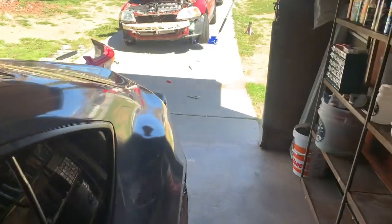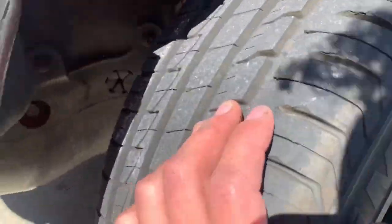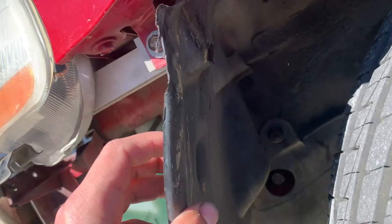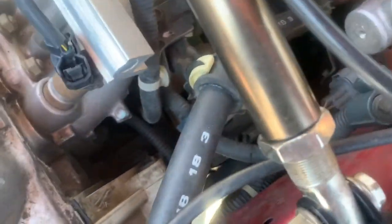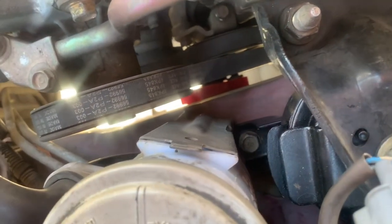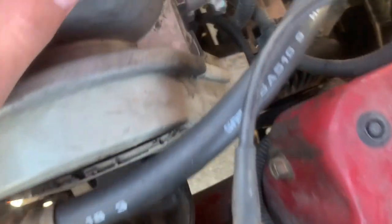Now it's going to be doing the power steering and all the belts, because she needs new belts. We're going to start with that. I'm probably just going to turn my tire — I'm not going to take it off completely because I can see it. I'm just going to pull off this little cover material right here and then go from there. All right boys, so we do got to loosen up this power steering — there's a bolt right here, and then there's a bolt back there, and then you also have to do the alternator to get that belt. Then we can start with the power steering and then the alternator belt.